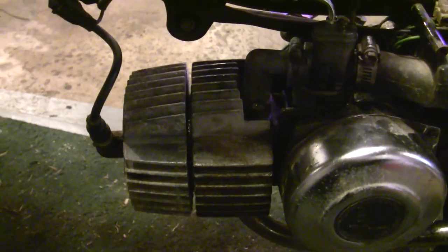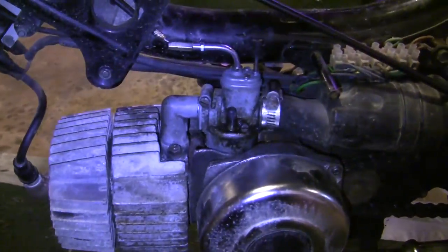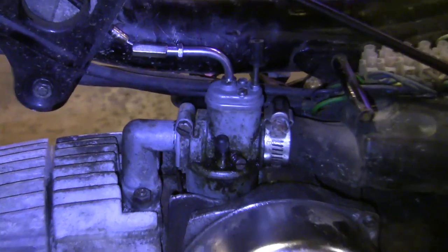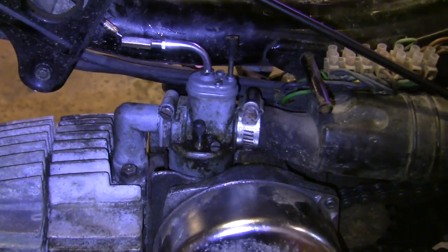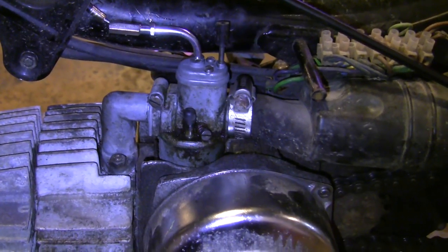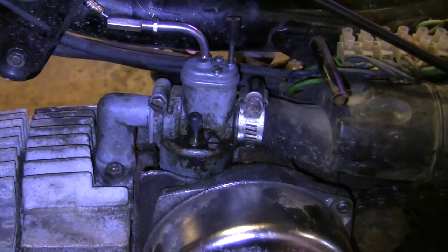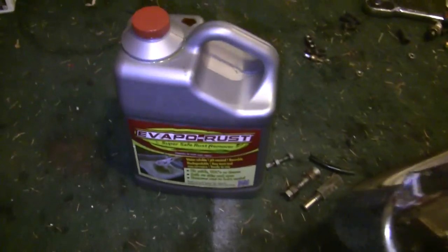So I'm thinking that with a hone and some new rings combined with also, here, let me get a little bit more light here, also going into that carburetor. This one had a 70 jet in its stock, which is way too big. Combine that with the other internals, the way they would limit the speed on these bikes, in addition to, you know, cylinder porting and whatnot, they would inherently richen the carb. So on one hand, I'm probably going to find stuff in there like the 212A atomizer and the rich needle, and we'll see what playing with some parts there does. And yes, I still need to do the tank, but that's going to come later today.